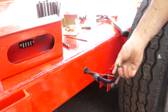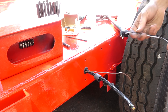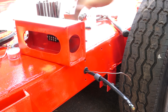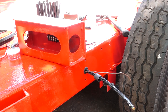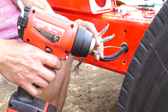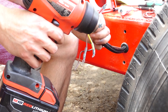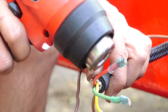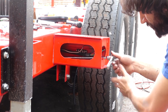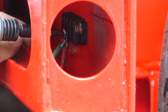So this side is not too crazy. I have the feed coming in from the front of the trailer, this is gonna go back up to the front markers, and then I have the side marker here which is gonna go into the side of the box. So not a whole lot of connections in this one, but the other side will be a little more exciting. It's the same thing again — heat shrink ring terminals, make it look nice, screw everything down, and this side should be good to go. It's a lot of the same thing — just rinse and repeat constantly.